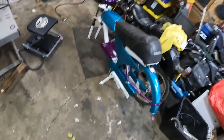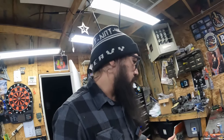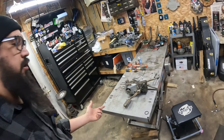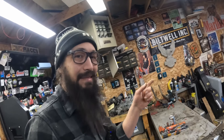The motor is going to drop underneath all of those. We got some new vinyl stickers made and I have the motor back on the bench. I've been putting off taking this apart, going back and forth on whether or not I was going to do it. But it doesn't make sense — we're putting a kit on it, so it's going to be a 70cc, not a stock 50, which means it's going to see way more power, double the power in terms of mile per hour top speed. Doesn't make sense not to spend 50 bucks and freshen up the bottom end. I'm not doing anything with the crank. If you have a Puch, a Derby, a Honda Hobbit, or a Moto Guzzi, you can get an aftermarket stuffed crank. Garellis, unfortunately, there's not a huge aftermarket for the cranks, probably because the clutches are terrible — absolutely terrible. They're rubber, they overheat, they melt, and then you run into all sorts of issues that we're probably going to end up dealing with down the line.